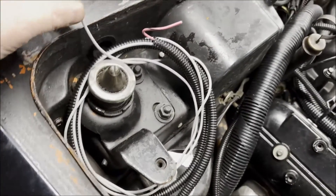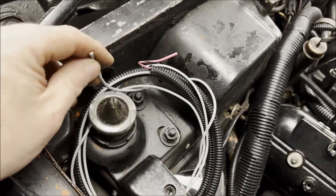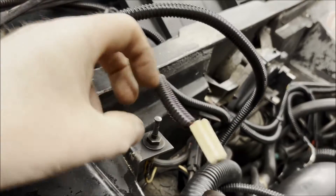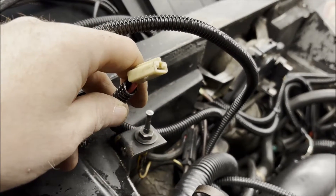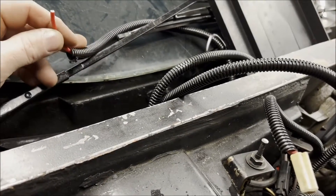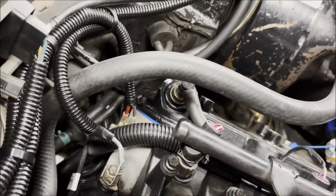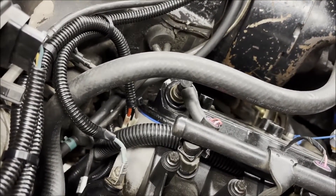The other two wires to deal with: the gray wire will power up the fuel pump once key is applied, and the pink wire wakes up the ECU. For power, we're going to utilize the existing plug from the HEI distributor — it has 12 volts in the on position and in crank so it never interrupts 12 volts. We'll use that to power up the ECU. The red wire goes to the fuel pump and the brown one runs back to the head. All grounds are tied back to that central point.